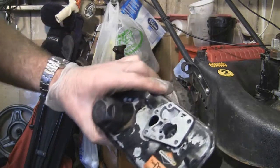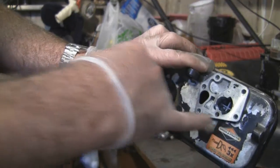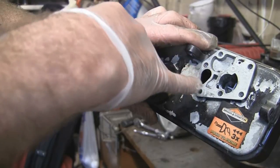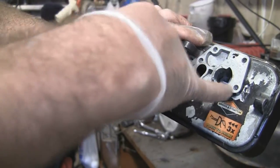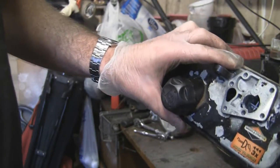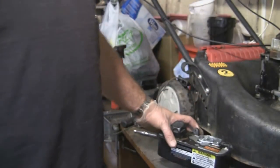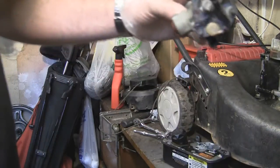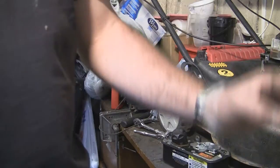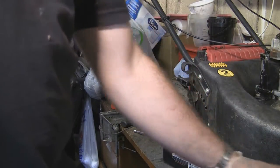Also make sure you're cleaning in here, because these little holes are always quite bad - you can see that's absolutely filthy in there and it wants a good clean-out. These little tabs have got to fit over all these parts onto the petrol tank, and if it doesn't all fit together properly it won't supply fuel properly to the engine. Make sure everything's clean and the diaphragm and gasket is good. Put some carb spray through and make sure these filter tips are particularly clean - make sure you can see through them. Obviously be careful there's no petrol in there when you do that.